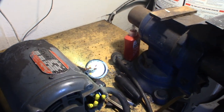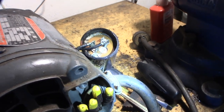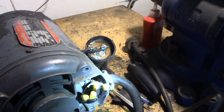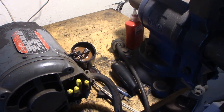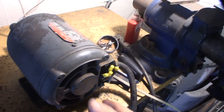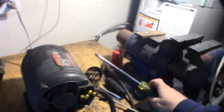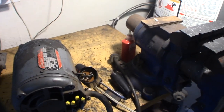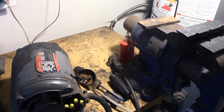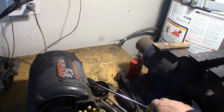I don't know if you can see that, but it's kind of leaking. You can kind of see how it's corroded — it looks like it's leaking. I'm going to test it, but I'm obviously not going to reuse it because these things don't last forever. You want to make sure it's discharged — that's why you want to discharge it. I wasn't actually expecting that kind of spark. Obviously it's a good capacitor, but that's why you don't want to work on your motor without discharging it first. That would hurt bad.